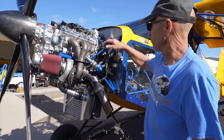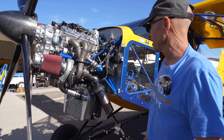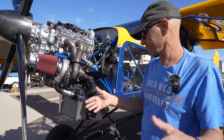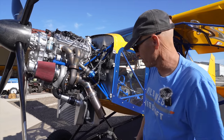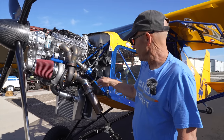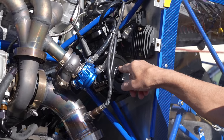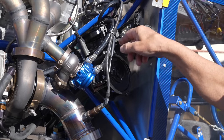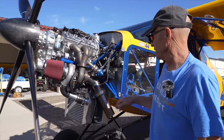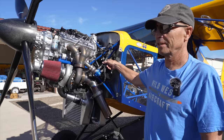We build the coolant tank, the motor mount, and the oil tank. I pretty much built the intercooler — just got a core and some flat metal and made the tanks on the end. Here are the two electric water pumps I was talking about — they'll pump 21 gallons a minute. Running just one of them is doing a really good job of keeping it cool, and they're going to be on their own separate switch.